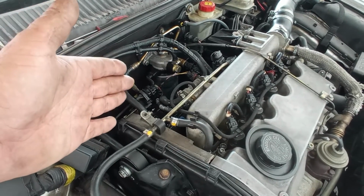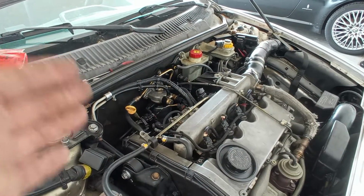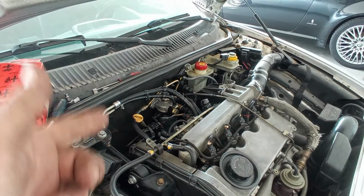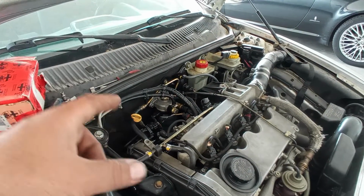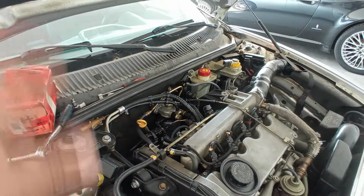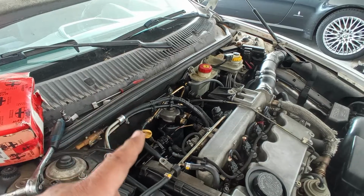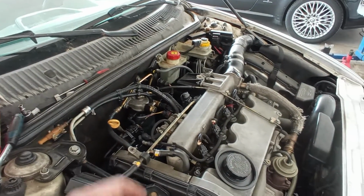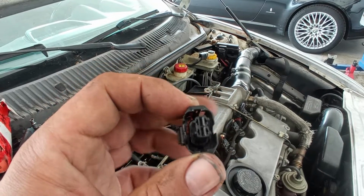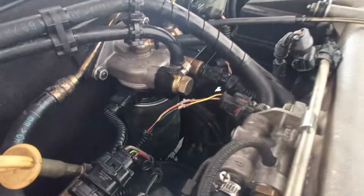The high pressure fuel pump went to the specialist and guess what? It was totally destroyed. Even the main shaft had to be new. It was worn out. One of the pistons was bad, some spheres, washers and whatnot, everything on this pump was very, very bad, except the regulator. That was good, but the connector to it is totally destroyed and the seal is missing. So I'm doing here a repair on the new one.